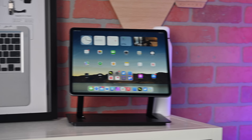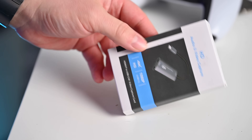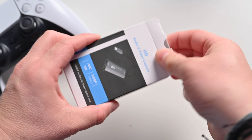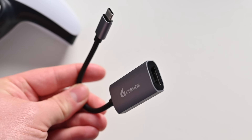Assuming you have an iPad running iPadOS 17, you're also going to need some sort of HDMI adapter — a capture card. This is the one I'm using; there are a ton of them available. I will say the Elgato capture cards did not work for me, so avoid those for right now. There's a link in the description — it's about 15 bucks on Amazon. The capture card has an HDMI input and connects to your iPad over USB-C.